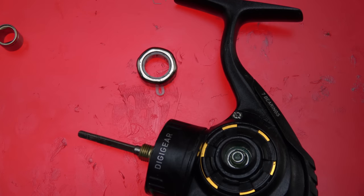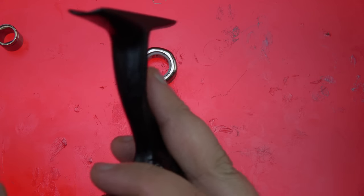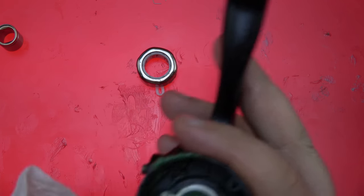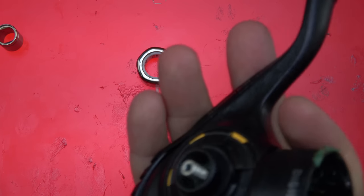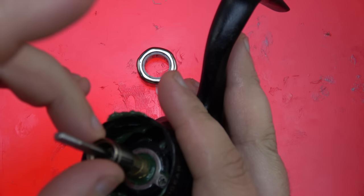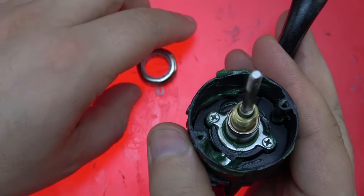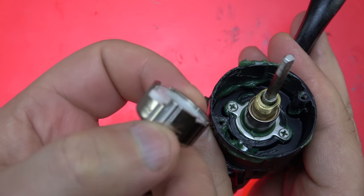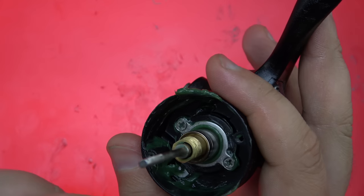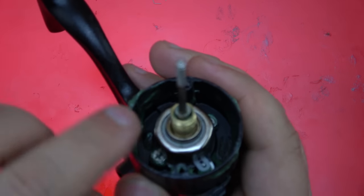and if you get it too contaminated, you're going to hit it with some solvent or denatured alcohol, and we're going to go ahead and move this grease out of harm's way. I'm grabbing it from the top so my hands aren't going to contaminate the part that interacts with the clutch. That should be good, because if you look at the base here, there's a little bit of clearance, so that little bit of grease down there shouldn't have any interaction at all with the clutch. And this stuff likes to stay put. And boom.